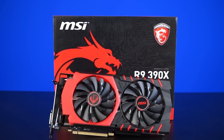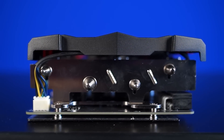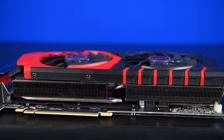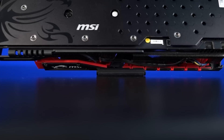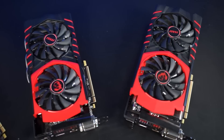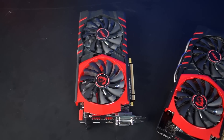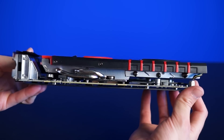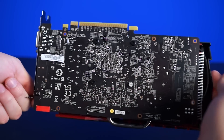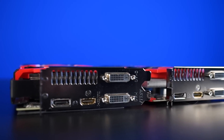Let's start with the R9 390X. It's got MSI's latest twin-frozer cooler on top with four massive heatpipes. This one is thicker than normal and will take up two and a half slots in total, so keep that in mind if you're using it in an ITX case or Crossfire. They've also updated the backplate design with a matte and glossy dragon design that's actually pretty badass. The other two cards, the 380 and 370, feature twin-frozer coolers that just take up two slots total. The 380 comes with a three heatpipe design and a backplate as well, while the 370 only has two heatpipes and does not come with a backplate. All three cards have the same outputs: one DisplayPort, one HDMI, and two DVI.